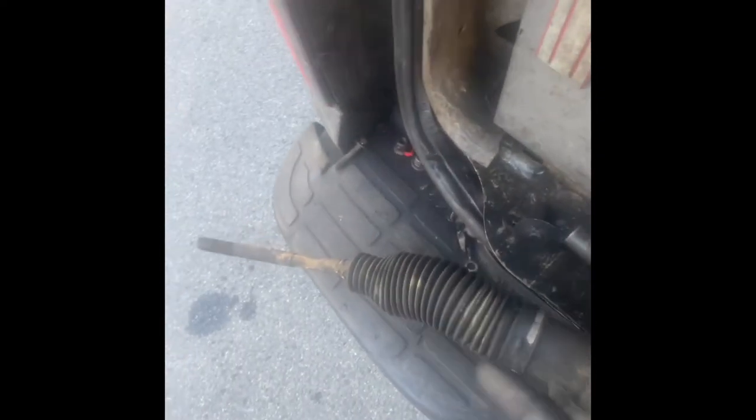As you can see, we got it off. It wasn't a big issue at all to get off. I already showed you guys how to take it off. Now these bushings - you don't need to do anything special because you can just tap these out. Stick a flat head screwdriver in between the rack and this and pry it out. It comes right out. But you're going to have to tap it back in, of course. You just need some pliers - monkey pliers or big jaw pliers - just to hold this in place while you pry this out.